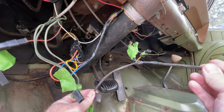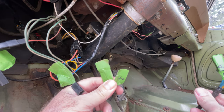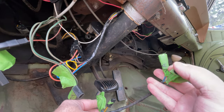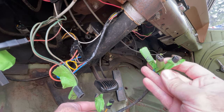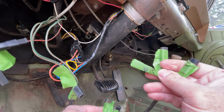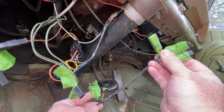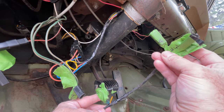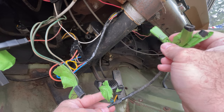This harness is fine, the connectors are cleaned - I need to put new connectors on here because somebody cut them. Looking over the diagram trying to figure out how this would have originally been set up: we have two powers here - this one is for the starter and this one is for the kickdown, best I can tell. These plug in up on the ignition switch on either the accessory or ignition terminals. Right now the starter is plugged directly into the ignition switch, so you turn the key and it starts regardless of what gear it's in.